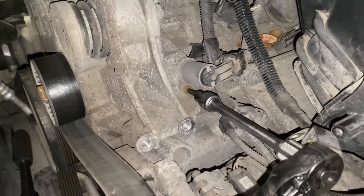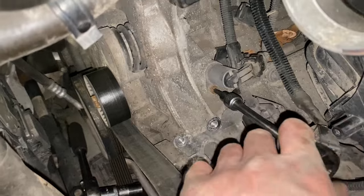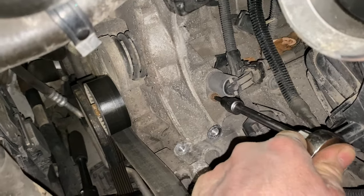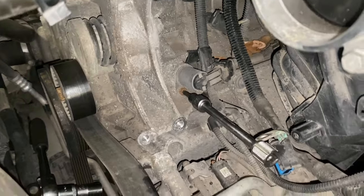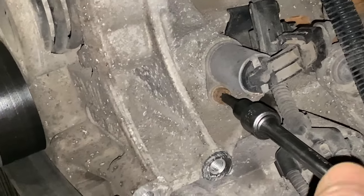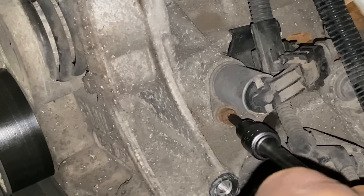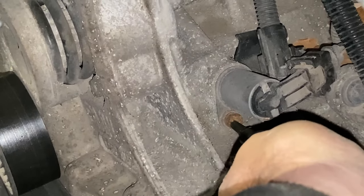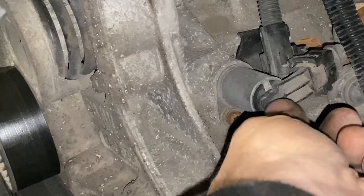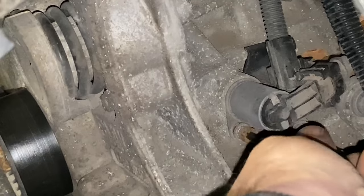So let's look at that valve now and see what we can see. You want to get yourself a nice stout, good strong Torx 30 and get your hand on and give it a good sprag, because really they round off very easily, and if it rounds off you're going to be in an absolute world of pain. So I took the alternator off really because it's just easier if you get it out of the way. Word of warning with these, many years ago when I fixed a lot of these, when they've been in quite some time and the engine, should we say, not been quite so well looked after, they snap off in the block and they're a goddamn nightmare to get out.